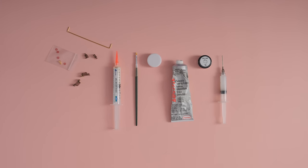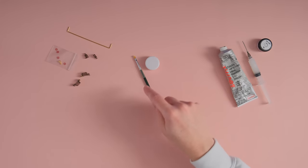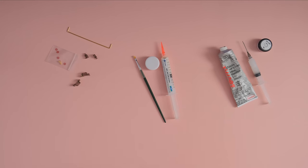I honestly think to get the best tuned stab, you're going to need a syringe of some sort. My method involves a very light application of everything beforehand, and then after installation I go in and retune things. Syringes have become invaluable for that. You can do everything with a brush or toothpick if you're careful, but I urge you to get a syringe and fill it with your lubing material. To group things up: the wire materials are for the stabilizer wire only. The 205G0 plus brush is only for where plastic meets plastic.